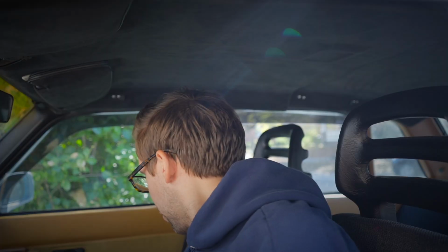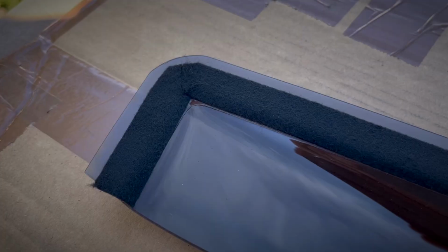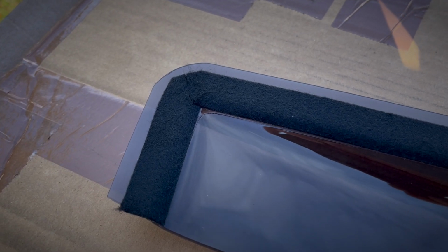And where's better? Where did I put better? Oh, better. This is felt, 1 millimeter thick by 3/4 inches wide. Don't get hung up on that conversion. I didn't. Now, just like a night I wanted to forget about in college, it's got a sticky back to it. That means you can apply it directly to this edge that goes in the groove. And being that it's only 1 millimeter thick, you can kind of stretch it around the edges without getting it all crinkly and nasty. Now, if you do have some sharp corners, you can V-cut it or pie cut it if you're into food like I am, and that'll get you where you need to go. Basically, you just put this on the edge. That's all there is to it.